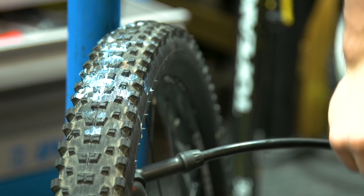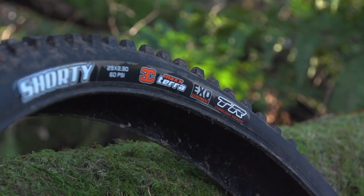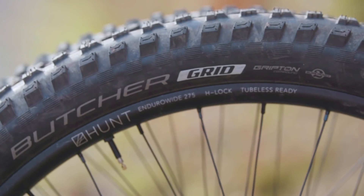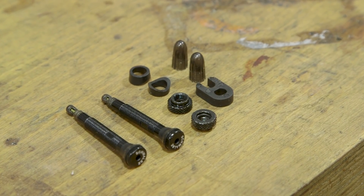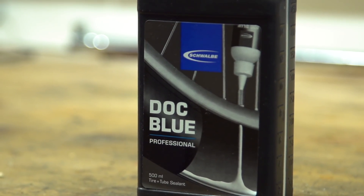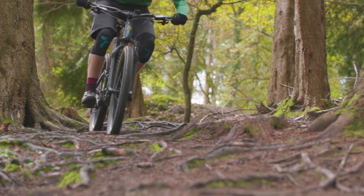So what do you need to buy? These days the majority of tyres and rims are ready to go tubeless. Tyres will almost certainly mention it on the sidewall, and most rims can be converted if they're not ready to go. You may well need some tubeless tape, a pair of tubeless valves, and some sealant. A safe bet is Stans or Doc Blue from Schwalbe, as it's basically the same stuff. Around £40 or $50 should be enough for the full conversion.